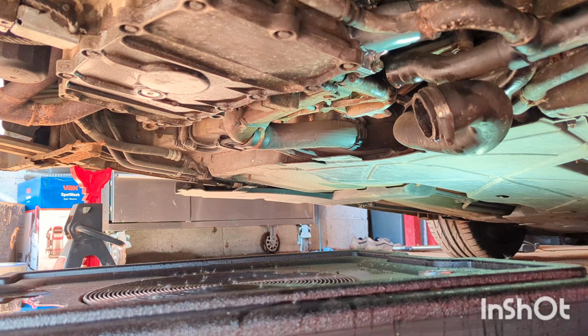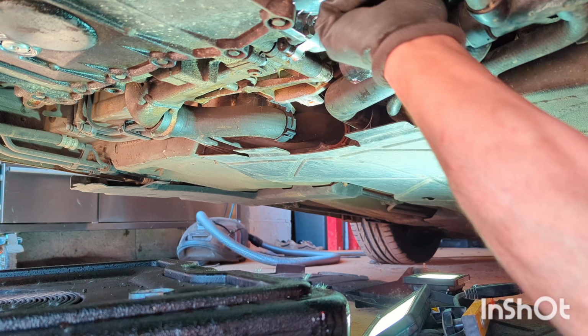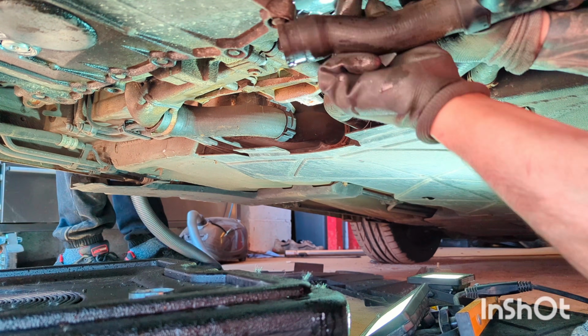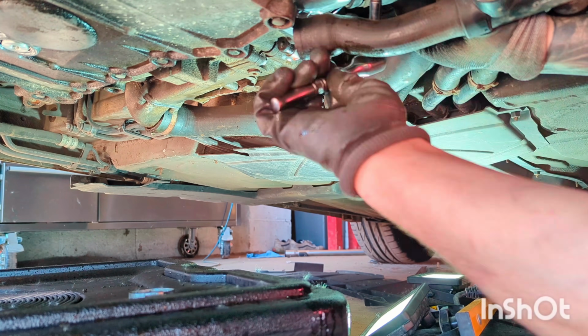And I just went and tightened up everything down below, got everything into position, and once the water pump was in, reattached the two hoses, which was all we needed to empty out what was a significant amount, if not all, of the coolant that was in the car anyway. When we emptied the catch tank, it was close to 16 litres, which is what these cars take anyway.